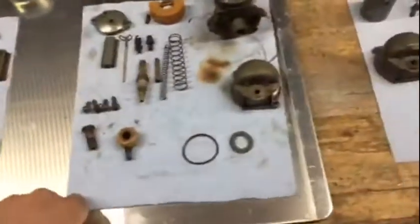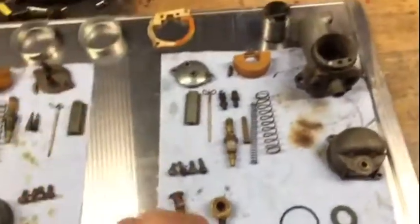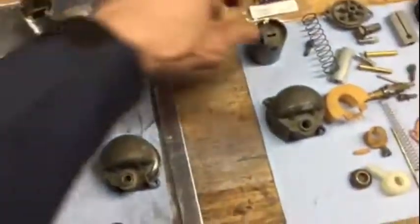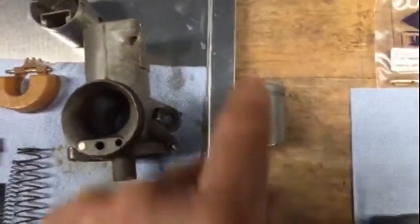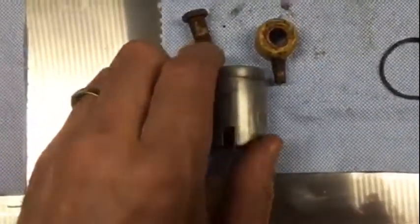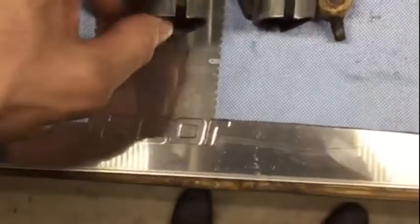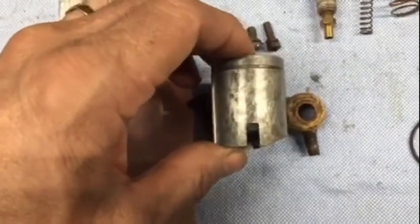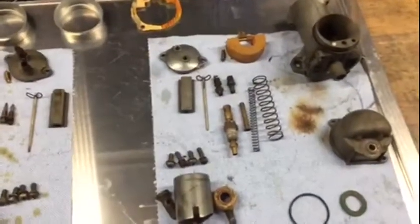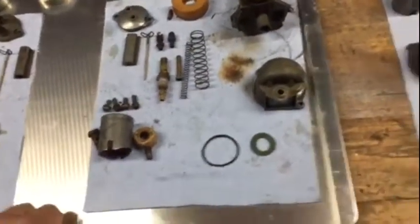So I got them all sorted out from left to right. Some of the variables in these carbs are the needles - the taper on the needle can be a sharp short taper or a longer taper, so I've got to check that. You can buy different slides too - they may come for different years, and it's the angle that creates the venturi effect. There are different angles in carbs, at least in Hondas and Yamahas, probably Nortons too. I've got to make sure the angle on this one is the same as that one - might be different on the Combat and the 850s. The needle has to be exact, and the jetting I can re-jet and clean the jets up. So there's lots to look at on these three carbs to make two good ones.